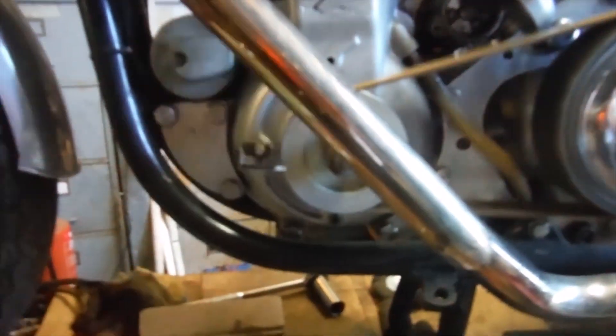We've got a new strobe. I've actually got the ignition timing on this Triton set how I want it, but obviously I haven't got another hand — I've only got two. I'm holding the camera on the strobe gun and it's on a fast tick over, but it does actually advance up to the full advance line at 35 degrees before top dead centre and holds steady. So I'm happy with that. That's another part of the job sorted.